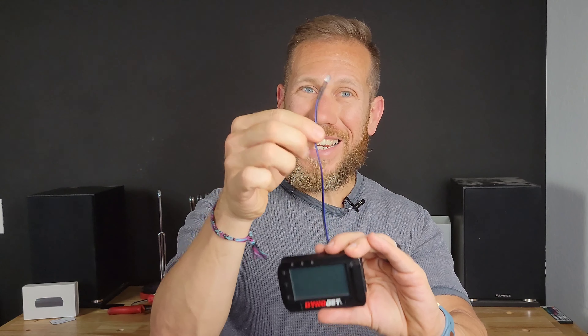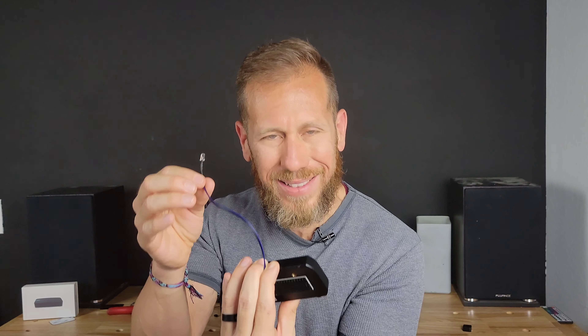The throttle alarm will confirm I have my throttle fully open. For the shift light, if my rev range is around 12,000 RPM when I need to shift, I want the light to turn on at 11,500 RPM. What we're doing is soldering LED leads onto the board so I can use the power being sent to the Pod 300's LEDs to drive external ones, giving me the ability to place them somewhere visible on the bike.